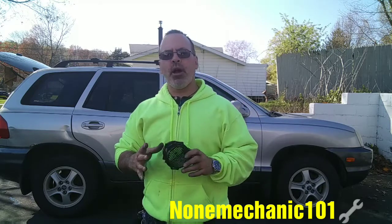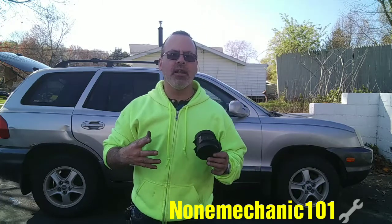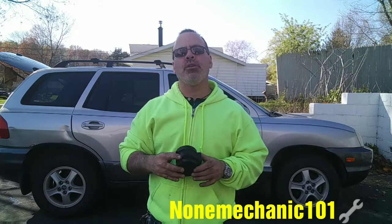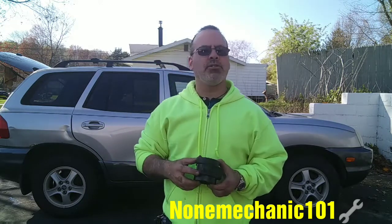I had a code, P0102. I had this problem for a while, so I thought it was the fuel pump. So I diagnosed it, I put in a diagnostic tool, came to find out that it was the mass flow air sensor. But before I replaced it, I cleaned it up, and still the same thing.